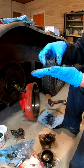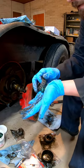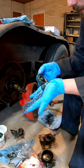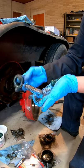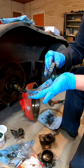Grab a couple dollops of this grease — just wheel packing grease. I just go around and force it inside. You want it between this outer race and inner race is where you need all the grease, so that it greases these rollers as they roll. I'm just forcing it inside that lip.